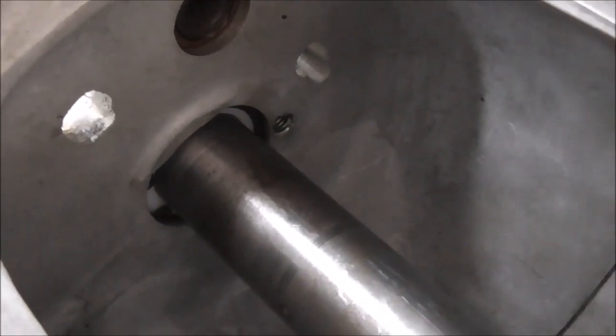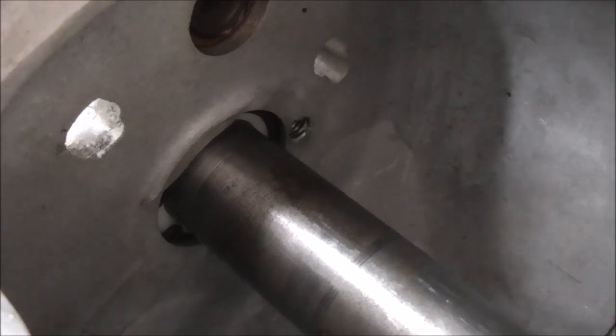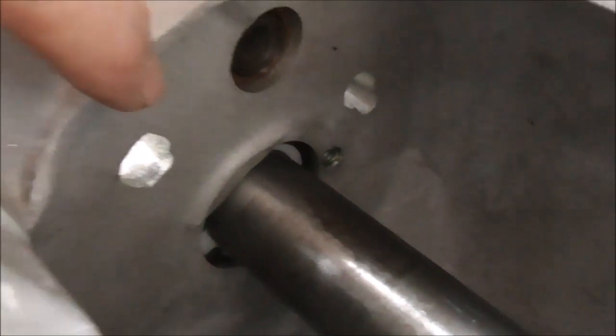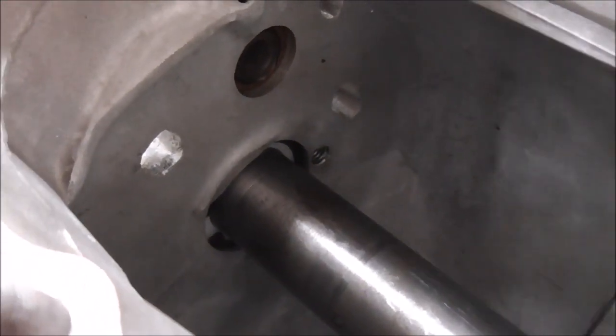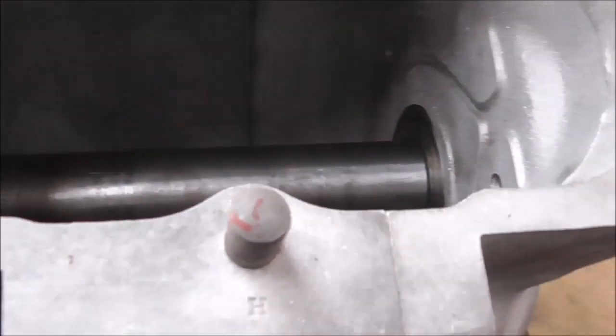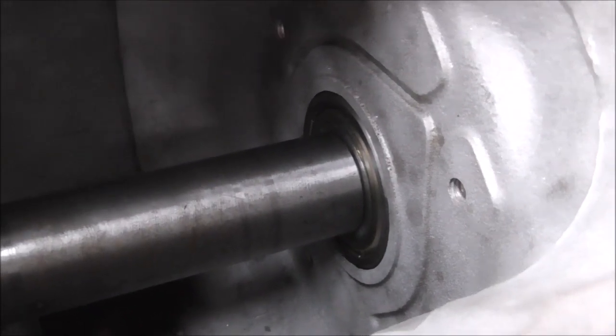So it looks, when it's assembled, it looks worse than it is without the spacers simply because you're not seeing the crank webs there so it looks a bigger gap. And the bush flange not being there on the inside makes it look like there's a bigger space as well. But remember when this is locked up to the drive side, as the intention is, then what happens over on the timing side won't really be an issue anyway.